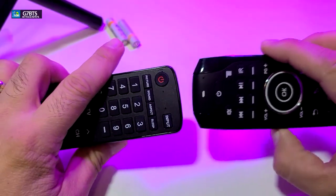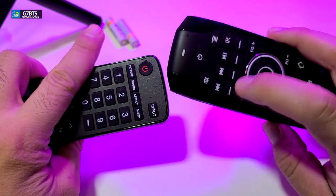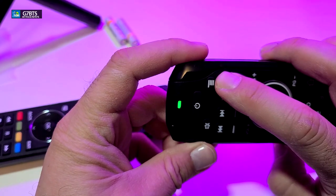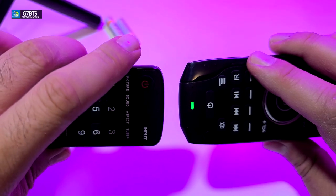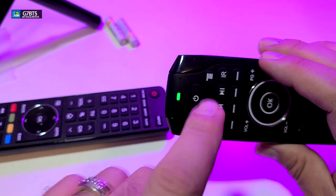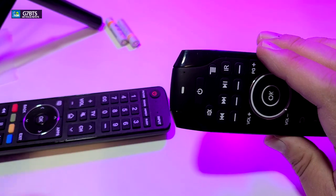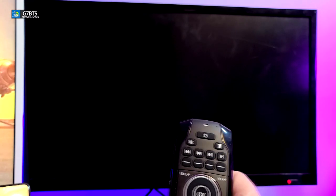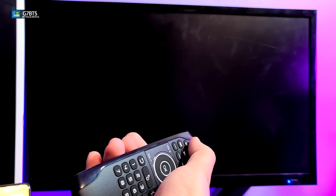A few steps to mention when trying to make your remote work with IR remotes — meaning to control your TV's power and buttons. When pairing for the very first time, press the power button once and then hold the IR button for a few seconds until you see it blinking. Once that happens, grab your TV remote, hold it close, press the power button, and wait. Once that is done you are set — press the power button one time and you are done. You can repeat the same process to program all of the other buttons at the bottom.